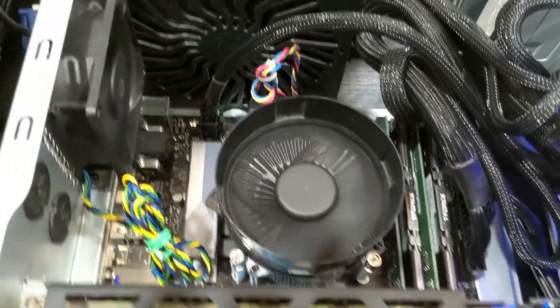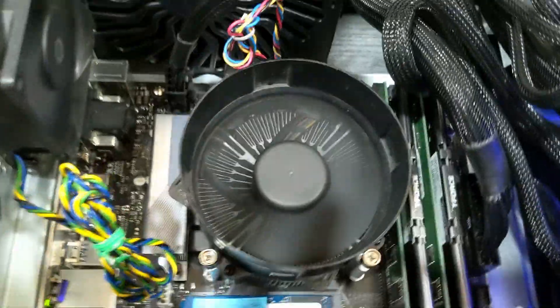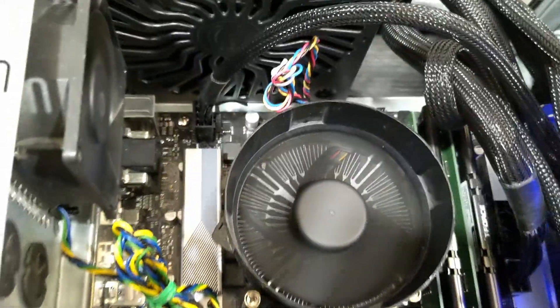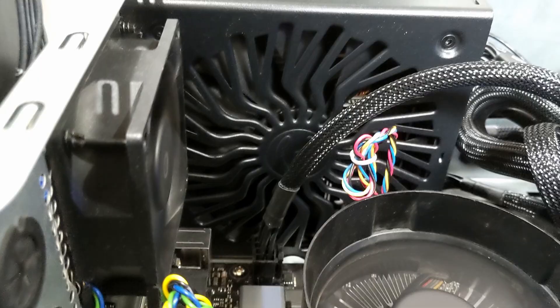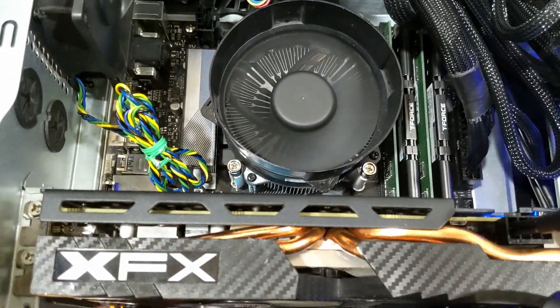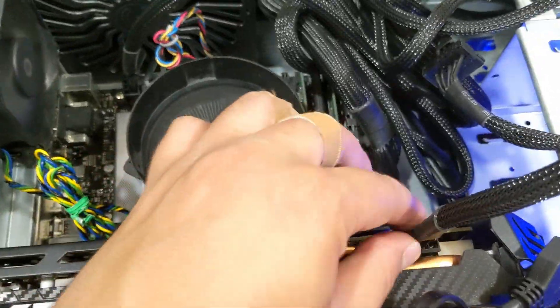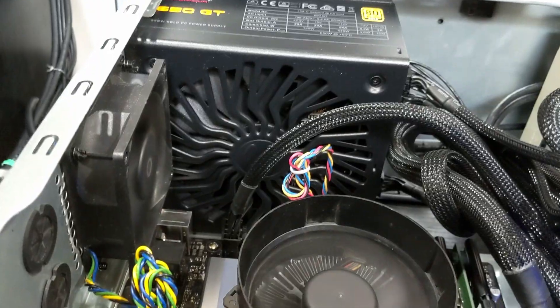Even in eco mode, I'm running a benchmark and the fans of the RX 580 are running, and the CPU is definitely working hard. I'm just not understanding how much wattage is necessary to get this fan to run, because it is not running at all. Even with a decent load — and it does use one of the GPU headers — it should be working.